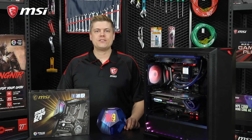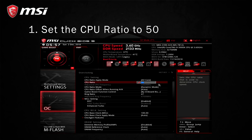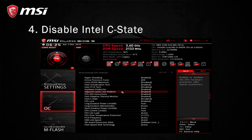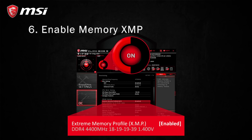It's actually pretty easy once you have the right components assembled. In summary: go into the BIOS and set the CPU ratio to 50; use auto for CPU voltage, or manually set the value; set the CPU core voltage mode to override, though auto should be the same; and disable Intel C-State for better stability. Run a quick benchmark in Cinebench or your bench of choice. Back in the BIOS, you can try enabling your memory's XMP, save, and benchmark again. For stability testing, we can use CPU-Z to check the CPU frequency, and CoreTemp or HWiNFO64 to check CPU temperatures and power.